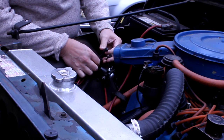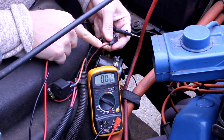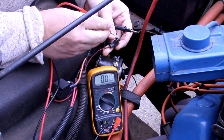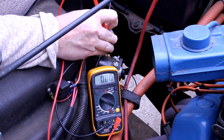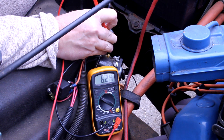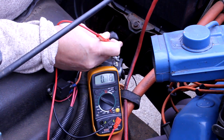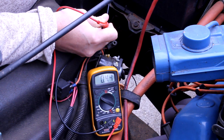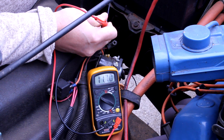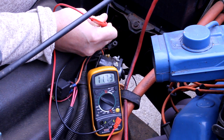We're going to test these for voltage to confirm what they're doing, because the red one doesn't fully make sense to me. The black wire with a red tracer should be my 12-volt run — I'll stick the probe in and ground it. In run mode: 6.2 volts, not 12 volts — not really sure what that is. Now testing the start wire — pushing it to start mode — and there we go, getting 11.6 volts. The battery may be a little low, but that's what I'm expecting.